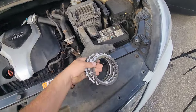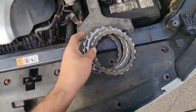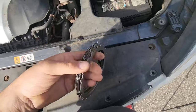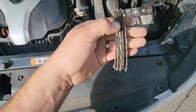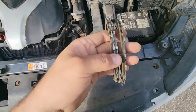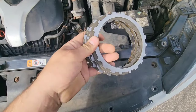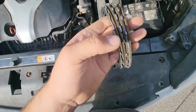But this is some clutches, and yes, an automatic transmission has a lot of clutches like this. You have a steel plate like this one, and you have a clutch. When the transmission applies a gear, it sends oil pressure and binds the friction and the plate together, okay? And between each of those circles, you have oil, the transmission fluid. This transmission fluid, with time, will become dark and full of metal particles if, for example, your transmission starts to wear, and it's normal, every transmission wears out.